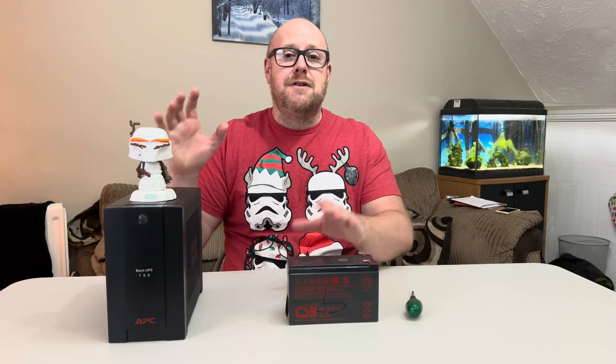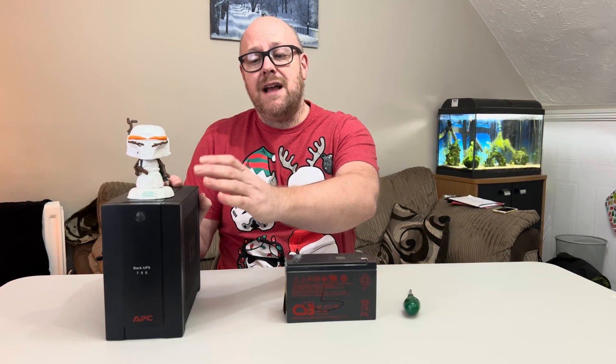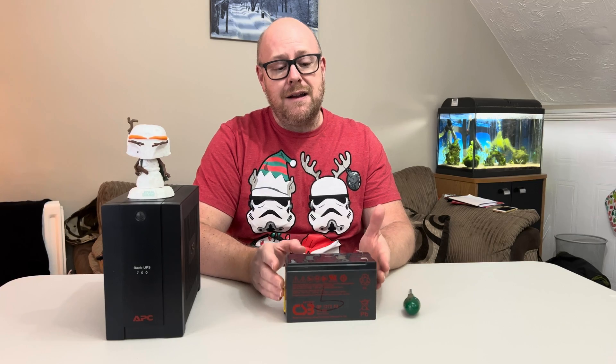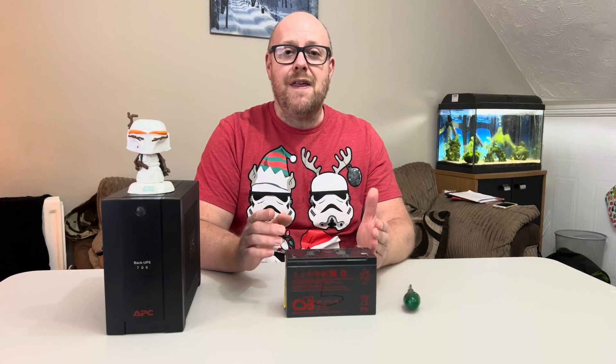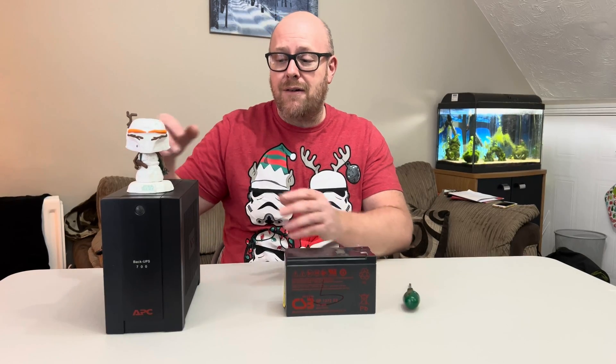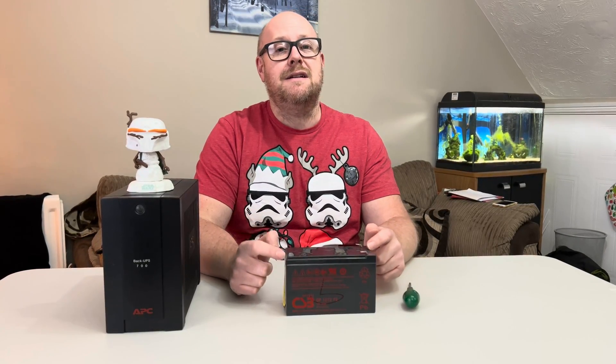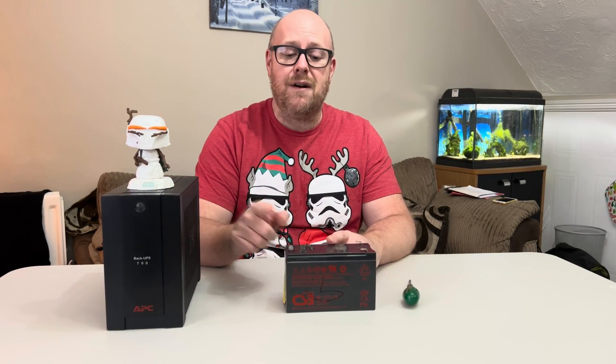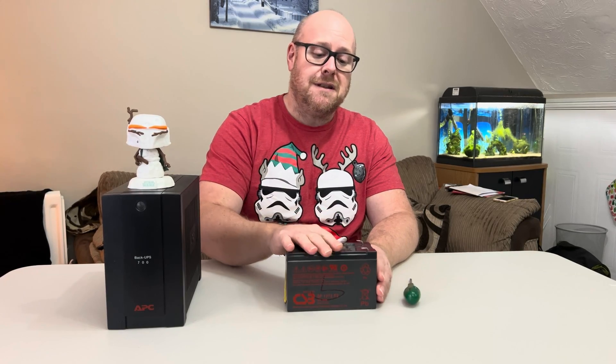So I thought I'd hook it up to my PC using PowerChute. When I did, the USB wouldn't even recognize it — I was beginning to think it was a faulty unit. But after turning this off and power cycling it once, I got it back up, it connected and it told me that the battery inside the UPS was charging. I let it charge up to a hundred percent, then switched it to internal battery — it immediately dropped to six percent. A self-test prior to that had been working, so I worked out it's the battery.